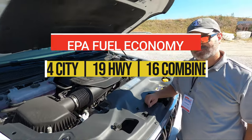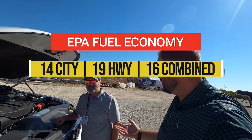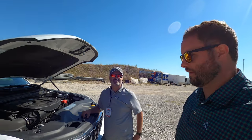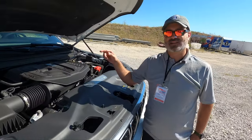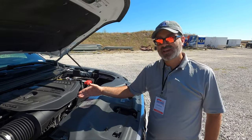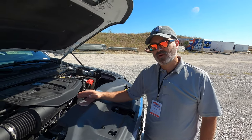It's more efficient and it's all-new architecture, based off the GME from the 2.0-liter we saw previously. This is now a 3.0-liter, so architecture-wise it shares the 2.0-liter from the Wrangler and the 4xe — the same 2.0 as the Alfa Giulia. It's been extended with two more cylinders. This all-new inline six is going to start appearing in a lot of Stellantis products, from trucks to cars.